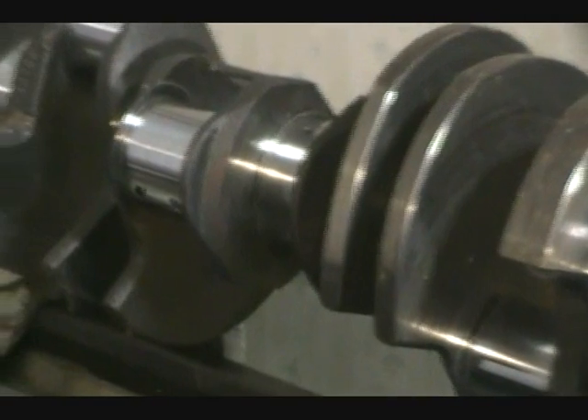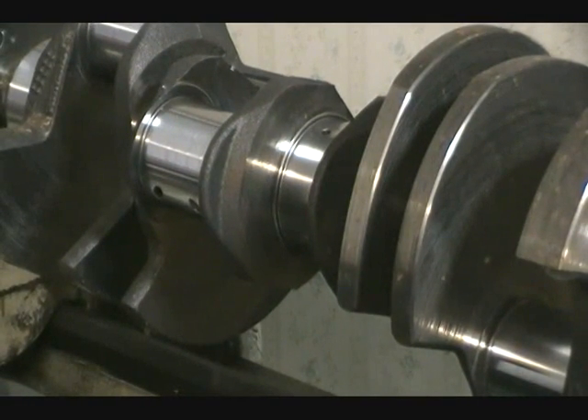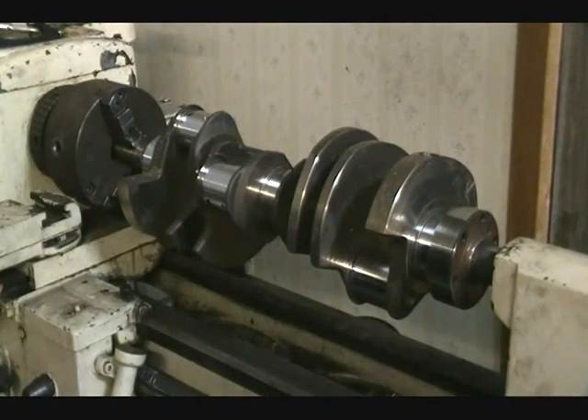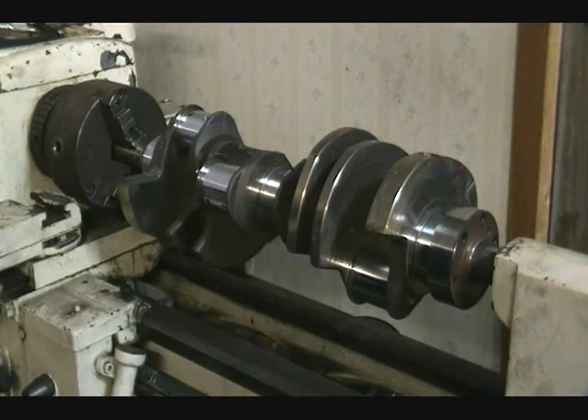As you can see, these all have a very nice finish to them now. If we wanted to save some money, could we just bypass not polishing the crank? No, you wouldn't want to bypass that. The scratches in the crank could destroy the bearings and take out the rest of the motor, so the best thing is to polish it and make sure it's within specs — it will make the motor last for a long time.